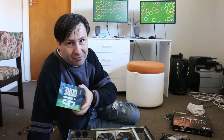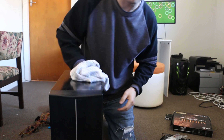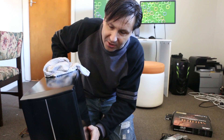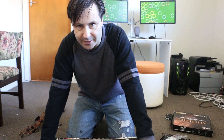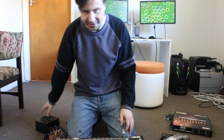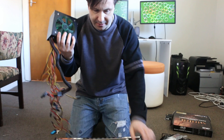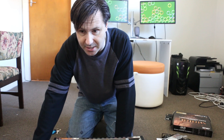We haven't bought these other components — they've just come out of the garage, a bit dusty. This is a case; in New Zealand this one cost me $100 at the time, but you could get a cheaper case. For graphics we're going to use one of the Ethereum graphics cards, a GTX 1070, and we'll just put one in. We've also got a power supply here. It's 500 watts, which is plenty to support this computer, though it's not super economical on power conversion.